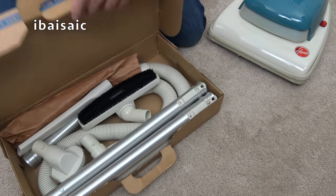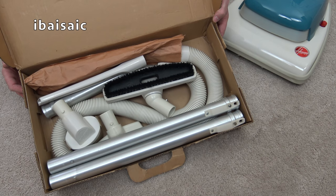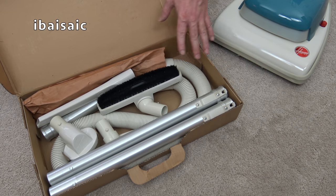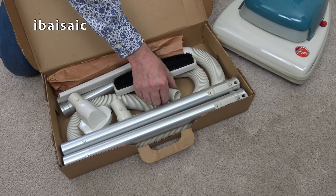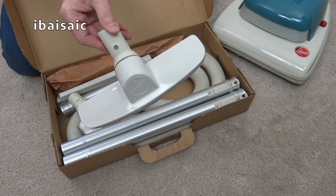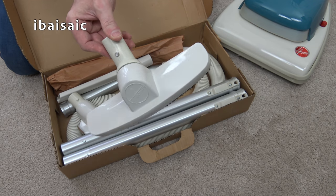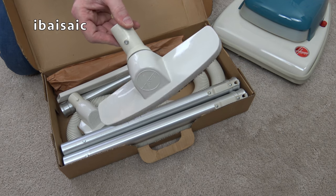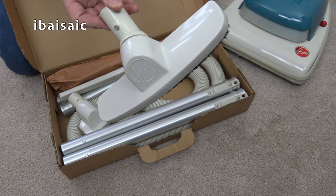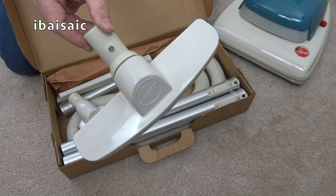So I bought these quite cheaply, and I don't think they were described as new, but they are. They've not been used. They've still got the original paper wrapping. They were slightly discoloured though, and I've cleaned them up. I got them out today and cleaned them, and they've more or less come up as new. They'd yellowed slightly, and I got rid of the yellowing. No need to retro bright. I just used some of the T-cut scratch remover on a cloth, circular motion, left it to dry, and buffed it up with another cloth. I should have shown you before, really, but trust me, that was quite yellow.